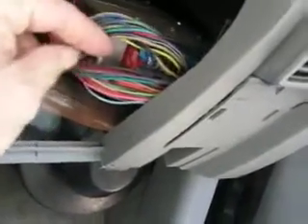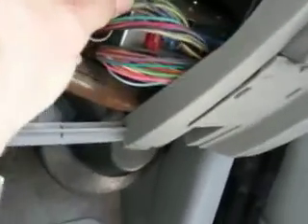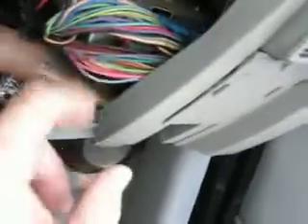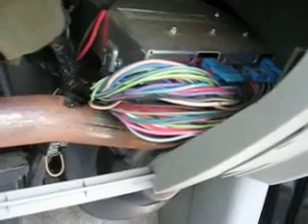Now if you see, here's my computer. There are several purple wires, and I've been looking and trying to find the purple wire and match it up to my manual. This dark brown wire here actually matches the heater wires, and then I have a purple wire right here. But there's also a purple wire in this top bundle. I'm going to remove a little bit of insulation off these wires, run the motor, heat the whole system up, and test those signal wires. If I get a signal wire anywhere from 100 millivolts to 1,000 millivolts fluctuating, then I know that's my signal wire. Once I find that signal wire I'll cut it, and I'll show you how to splice in your EFIE.